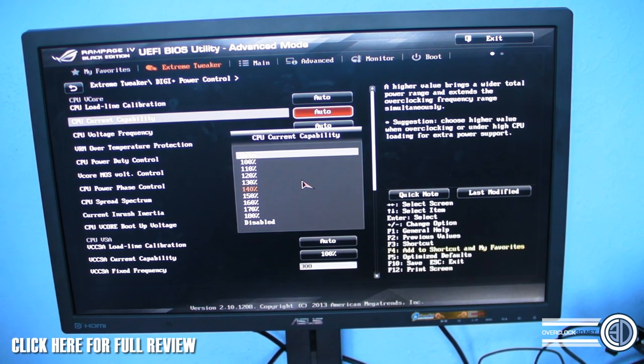This current capability one, for example, I did find personally, I don't know whether it's a BIOS problem or whether it's just something you don't really need to touch. I was always used to, with the other board, having to run sort of like a 120 to a 130 to be able to sustain very high overclocks and keep things nice and stable. With this board, I've actually found that you're more than likely, by touching this, going to start making things unstable. But obviously, I've only tested it with a 4960X, so when you start overclocking it yourself,